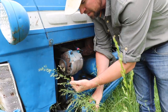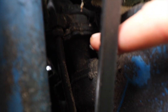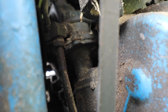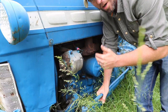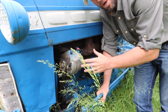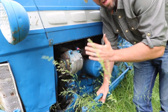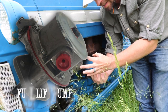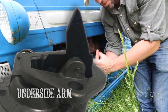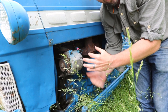If you follow the fuel line over to this side, what you'll find in here is a doohickey called a fuel pump. That fuel pump is a mechanical fuel pump, or a lift pump. On these older tractors, that's not an uncommon thing. Newer tractors may have an electronic fuel pump which turns on and off when the engine needs it. On these older tractors, the fuel pump is constantly moving up and down and pumping fuel as the tractor is on and calling for it. The fuel pump has an arm at the bottom that moves a valve up and down, which creates pressure that sucks the fuel from the gas tank up into the pump and then shoots it back out towards the carburetor.